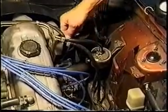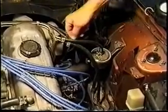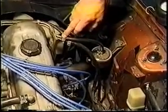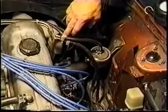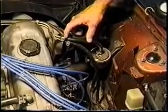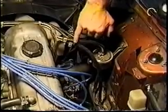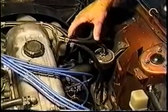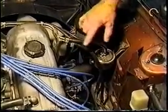The Society of Automotive Engineers has a rating system usually printed on the hose. If you get a long section of it, eventually it will say SAE: 30R-7 is low pressure, and 30R-9 is high pressure. The only difference between high and low pressure as far as SAE engineers are concerned is the difference between a 7 and a 9 printed on the side. 30R-9 is high pressure — the higher the number, the higher the pressure. 30R-7 is low pressure, rated at 36 psi.